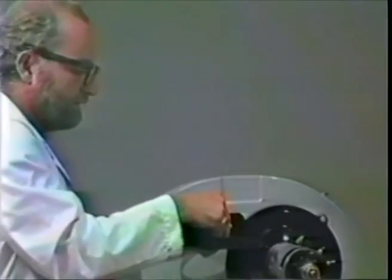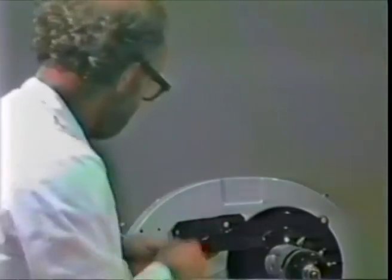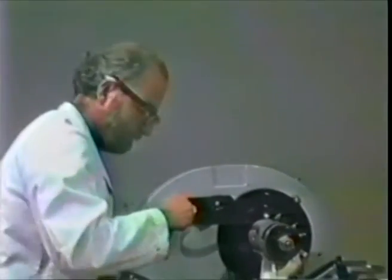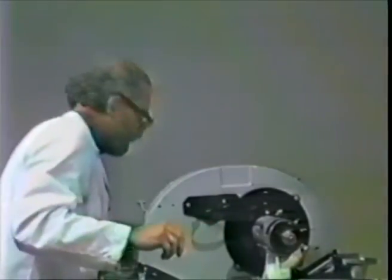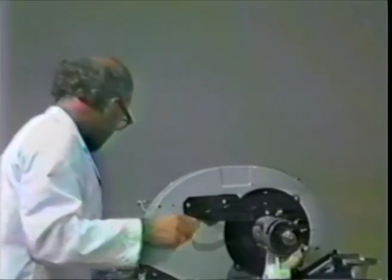Get the bracket that holds the oil filter can like that. You tighten it down, and it's not in this little groove here. You'll be redoing it to get it in this little groove. Put the other bolt through the fan housing. Sometimes they're a little snug. Actually, in this case, I think the bracket's a little snug. There. The other large bolt and washer goes on the front.